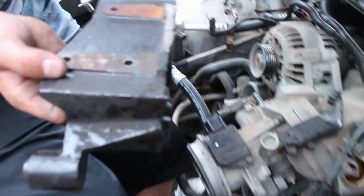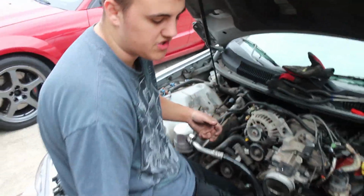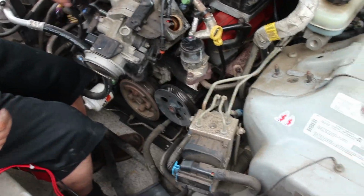Without the coil packs on, the intake can go right over it. It won't have to go up any. We can shave that down even. Yeah, we should. Someone already has, because they have this part that comes up for whatever reason. So someone took that down. Yeah, so we can reuse that plate and relocate it. We were going to make custom cables and everything, so that just means we don't have to make a custom mount for it.